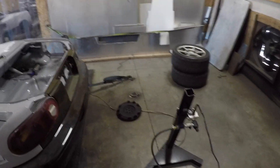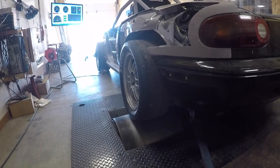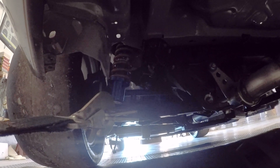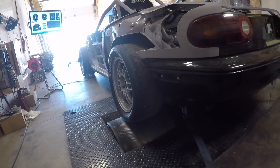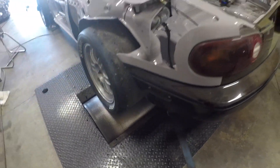One of the other things that's really interesting about a chassis dyno is you can actually see what the horsepower is at the wheels. However, depending on how you tie a car down, you can actually change that quite a bit. You can see here I have this car tied down to the lower control arm. Why the lower control arm instead of this handy-dandy hook that all Miatas have? When you hook there, you're actually pulling the chassis down and putting extra pressure on the tires. I've seen some tires get overheated on the dyno — when tires get hot, that can really vary the horsepower number. So I always try to tie down as close to the wheel on the lower control arm as possible. That works really well, especially on a Miata.